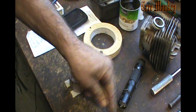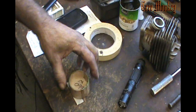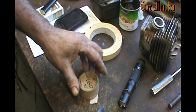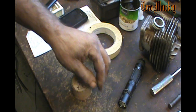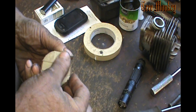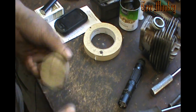You know, a lot of guys will just put a Sharpie mark in the cylinder and grind to the Sharpie mark. That's like 40 thousandths, 30 thousandths, 20 thousandths wide, whatever it is. Depends on how worn out your Sharpie is, I guess. I make sure I don't have any bumps from cutting that. And then we time it again.